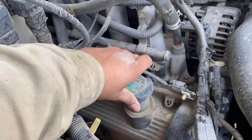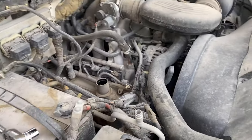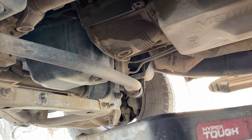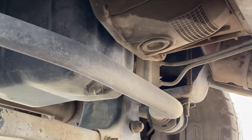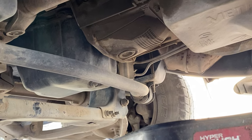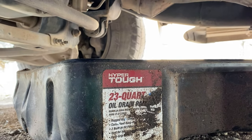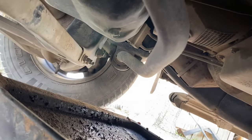First thing you want to do is take off the cap to give it a nice little stream. Don't mind my dirty motor. Second thing you want to do is go underneath the truck — or if it's a car, you might have to jack it up — and there's going to be a little bolt. Just got to find the right socket. In this case it's a 16. Make sure you get a drip pan; you don't want to spill this on the floor. If your truck was running recently, you might want to let it cool down and not put your fingers in the way.